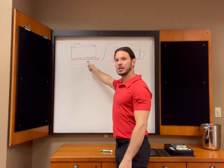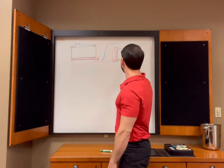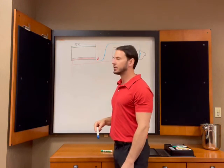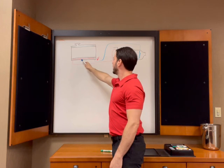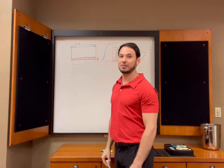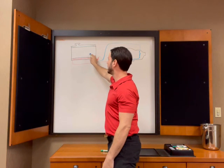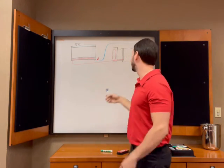But remember what I said here about the heat exchange, right? And remember what I said, we want this fluid to be at the engine temperature. So if I'm looking at it the other way, say it's 5 degrees outside, I started the car up, I'm leaving my neighborhood, I've got 190 here in my radiator, my thermostat's just starting to open, so I'm starting to get some heat in here. Then this ATF, especially in an SVX, if you've driven this car 1 or 2 miles and it's 5 degrees outside, this fluid in here is going to be 5 degrees. So it's going to go through here, and then the exact same thing is going to happen, because it's not intelligent in any way, it's just these two fluids interacting. So if this is the hotter fluid, it's going to transfer that heat into the ATF. And then as this ATF comes back out of the cooler, it's going to be warmer.